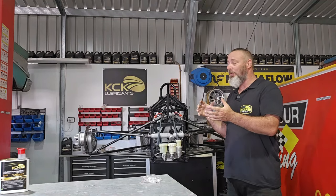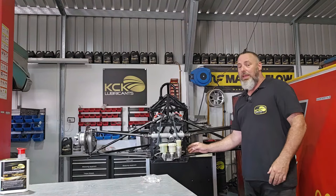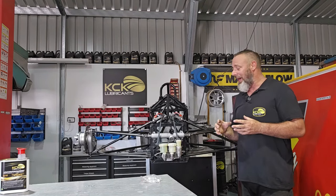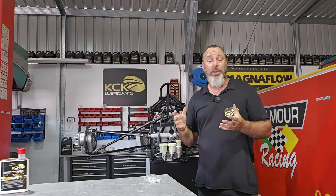There's also enough slack for the wheels to turn lock to lock. Even where it comes through here, it's on top of a suspension mounting point, so we need to make sure we're clear of that and not rubbing hard on any parts of the car. The front's done — it only makes sense that now we do the rear of the car.